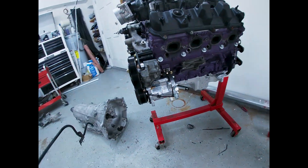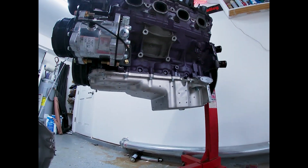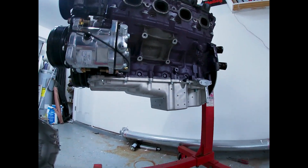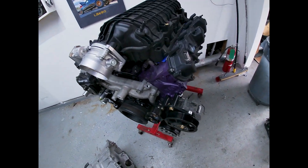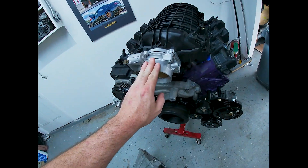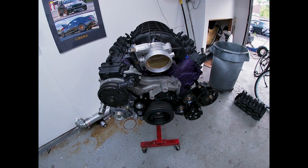So this will use the same AC lines, which is really nice. This is going to have a Holley swap-style pan for the LTs. This combination is a BTR 220 cam, some thin head gaskets, LT2 intake, LT5 throttle body. Pretty basic, nothing crazy, but it'll be a nice fun NA car.